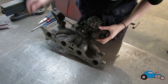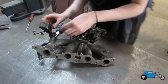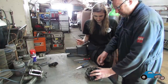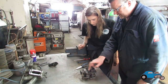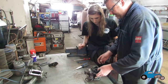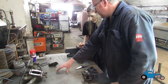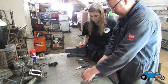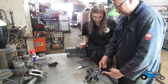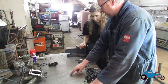So the first thing I'm going to do is remove the carb from the manifold. Next thing is to get the six screws out of there and get the top off. What you want to do is have a bit of cardboard — what I do is face the front of the carb with all the fuel and mark it on a bit of cardboard so that you know which jets are left and right, primary and secondary.